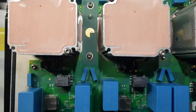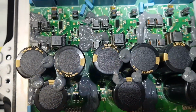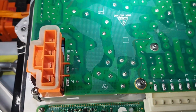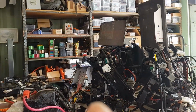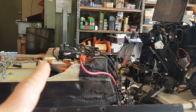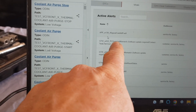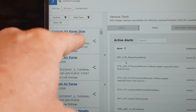I managed to source another PCS, and actually the whole penthouse components, from another Tesla tinkerer, so I thought, well, replacing the PCS is the next logical option. So Pyro's back in, it's all connected back up, connected the battery. Contactors closed briefly, then opened again, and that's because that PCS hasn't been paired. It's got a different firmware on it, which is confirmed here. It's the gateway: PCS, power conversion system version mismatch. So pretty sure then the CAN redeploy will fix that.